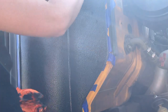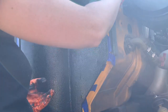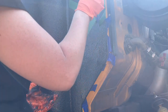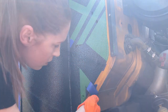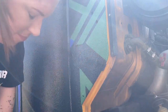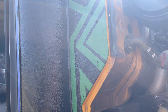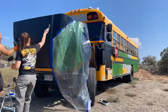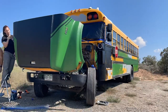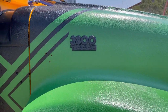You can reapply liner for up to 24 hours, but it's best to just play it safe. If you're doing a big project like this that's going to take days, you're going to have to do that. Now we're going to pull the tape — look how nice this looks. It is very sharp. This is probably the best I could get for this particular project. I'm pulling this right after I put on my second coat. It's really important that you pull it while it's still wet in order to get the sharpest line — if you wait, it will stick and pull the liner. Another tip: if you get any splatters from using two colors, as long as that liner is still wet on your second color, you can go in with some MEK and a rag and scrub the first color off to get a nice clean edge with no drips or drops.